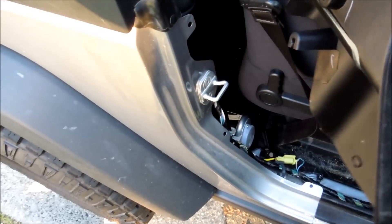After you get those three out it'll come right out. After that you can get that Christmas tree clip out there too. Once it pops out you'll force this out — there's one, two — it just pops right out. After you get this out and get that flex on there and rip on it that way, once that's out fold your seat back. You'll see carpet — pull the carpet back like so and run it all the way back through there. Tuck it in through here and when you start tucking it, it comes up and over back here.